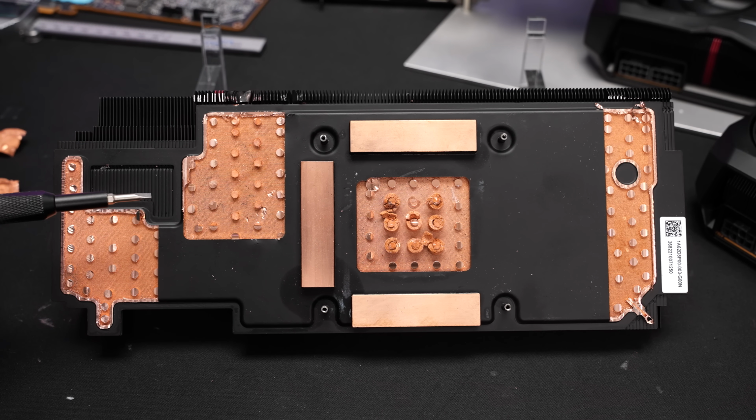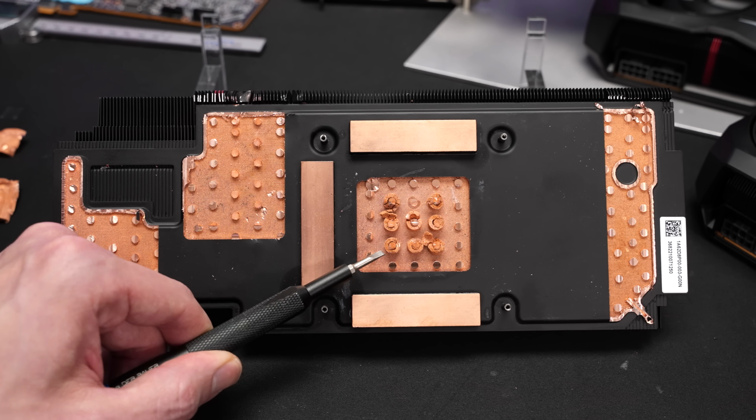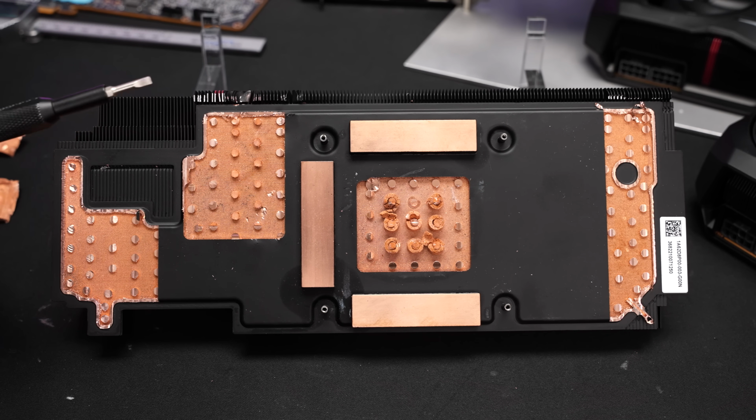that we have mesh in general, simply because, at least judging from heat pipes, there are 3 different types of heat pipes. One is grooved, one is mesh, and one is sintered. The sintered heat pipes are using the same material which we have on those studs right here, but they're using this as the inner mesh material. Whereas here we just have this normal net or mesh, which at least on heat pipes is only used for mid-performance or mid-quality heat pipes. And whenever you want to fight gravity and when you want to go for full out high performance, then heat pipes are always using this kind of sinter material. So I was a bit surprised to find this, but again, I'm not an expert on this field, so this is also just some speculation from my side.